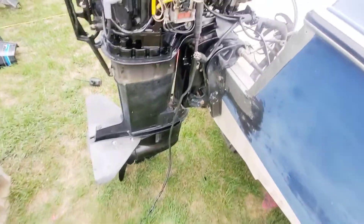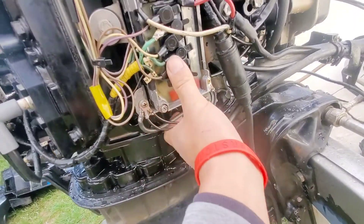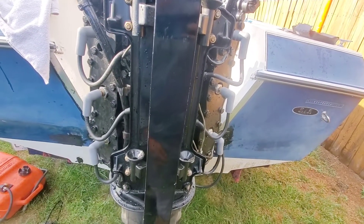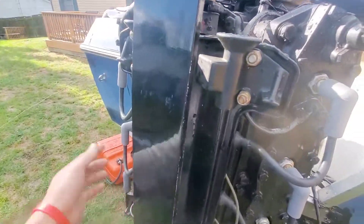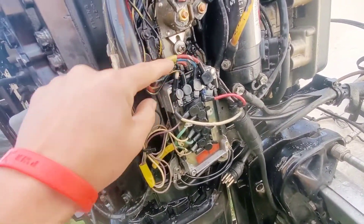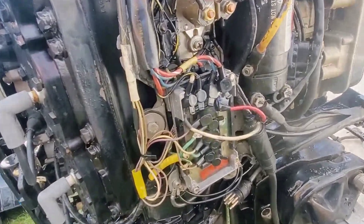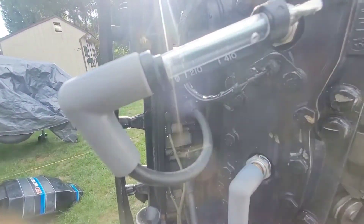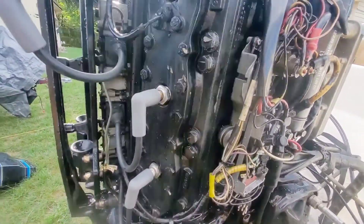So I'm going to do a spark test on this 1982 150 V6. We were back before I was rudely interrupted by a storm that lasted all day. All the boxes are in, all the wires are right, everything's grounded. I did a spark test and it did not give me what I wanted — I have no spark on four and one. Everything else does have spark. So I'm going to disconnect the kill switch to see if maybe it's a faulty switch. I hooked everything back up and I still got no spark on one and four. So it's definitely not the switch.